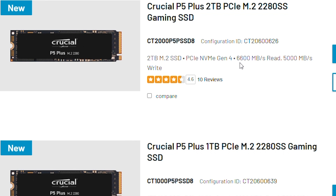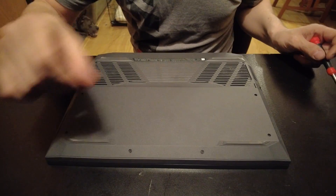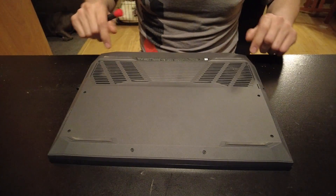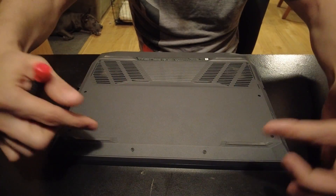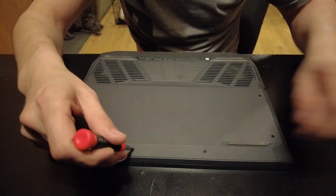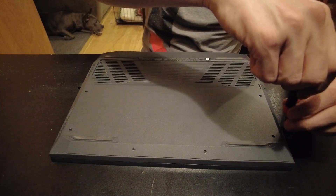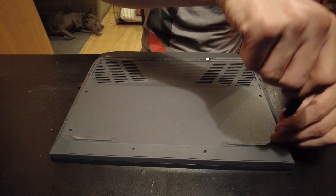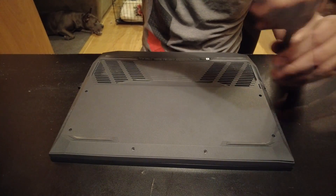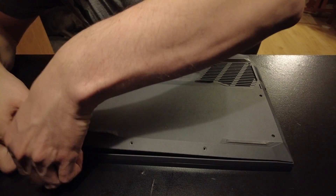It's been tested and confirmed to work in your machine. Start off by shutting down the computer. To open the laptop, there are eight screws: two here, two here, two here, and two here. Pull the outer two first, then the inner two — these four won't come all the way out as they're retained, so you'll hear them click at the end. Then simply start separating the case.